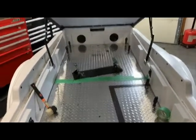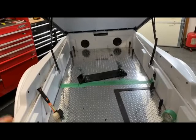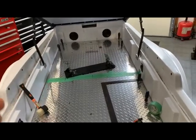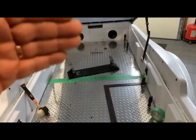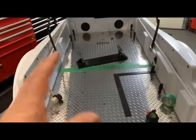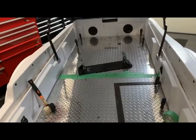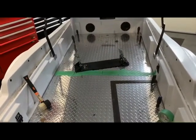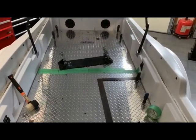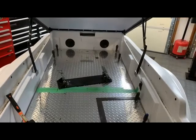Once the hardware is removed, it's a matter of figuring out where the biker bar is going to get mounted inside the trailer. Looking underneath, I know I've got to be at least 40 inches back to miss the first sideways frame rail and have some room. It's not perfect, but it's doable - so this is why we're making the video. That green tape and that line running sideways is exactly 49 inches from the leading edge of the checker plate.